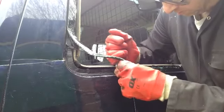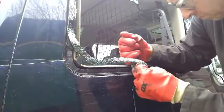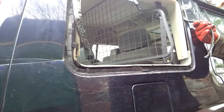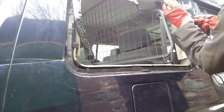This is going to be slow and methodical work. It's an inescapable fact that you're going to have bits of glass flying everywhere, even more than you had when it was broken. This bonding stuff is very, very strong. So instead of working away with long bits dangling everywhere, do a bit and then trim the stuff off - it's a lot easier. It's also inevitable that you're going to be slicing away little bits of your inner trim, but you're not going to see that.